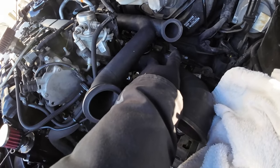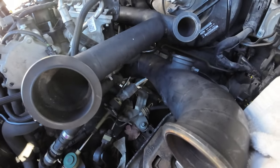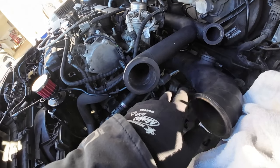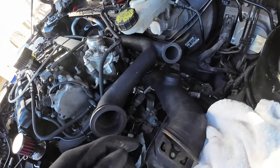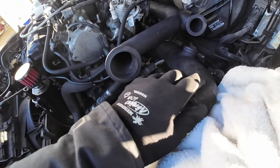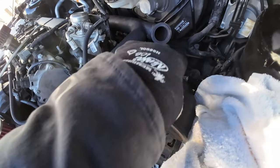We're gonna have to move this line. I don't know where yet. It's sitting high. If I could get it to sit a little bit lower, it could work. I could wrap it in some heat. Something to do with heat. I don't know. Heat wrap, something. So that's fine. Turbo's gonna sit here. All right. Wastegate is gonna recirc. It's gonna connect to both of these tubes.